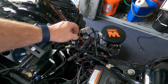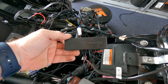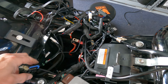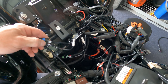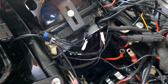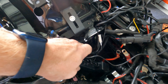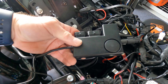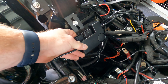I've got a lot of extra wires — it's a mess. These are the stock wires and these are the Custom Dynamics strobe and other stuff; I've got to stick it all back under here. So what I did was take the module and run the wires that plug into it through this hole, feed them underneath, then velcro the module up underneath the battery area on the frame — away from the battery itself. The Custom Dynamics will go below that and then I'll wire everything up.